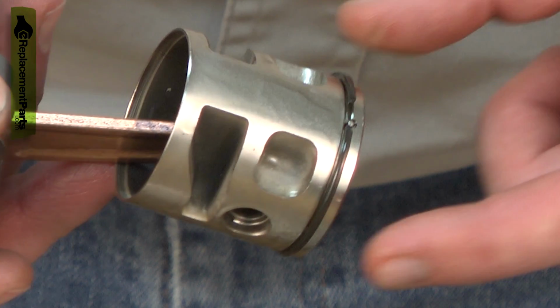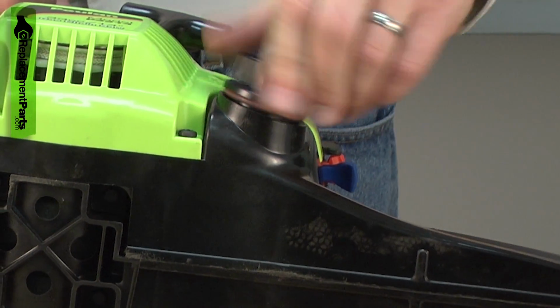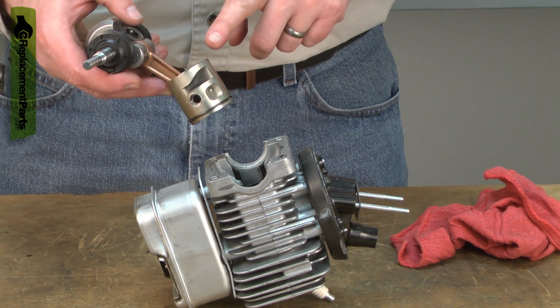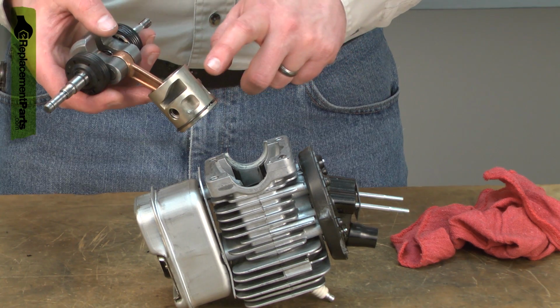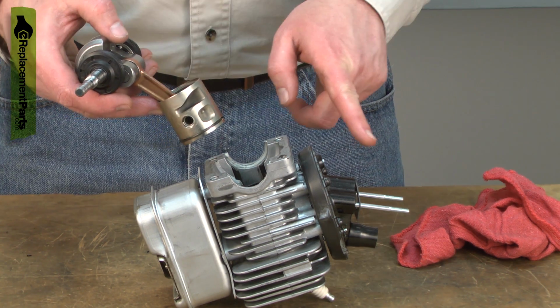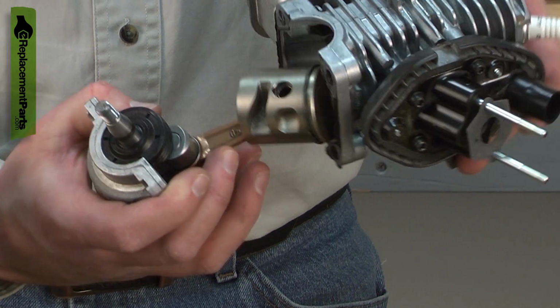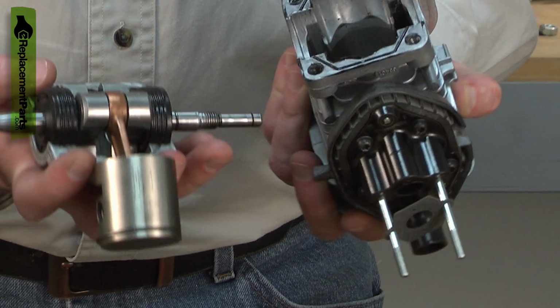During normal operation, the piston ring doesn't actually contact the cylinder. There's a thin coating of oil between the ring and the cylinder wall, only a few molecules thick. If the fuel used doesn't contain the proper mix and type of oil, the ring will make contact with the cylinder. The steel piston ring will quickly heat up and expand, which causes severe damage to it and the aluminum cylinder. Because the piston ring and the cylinder work as a pair, anytime there is ring damage, there will likely also be cylinder damage, so both components should be carefully inspected.